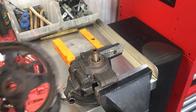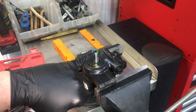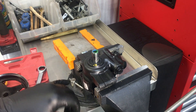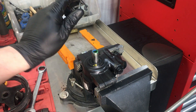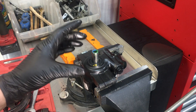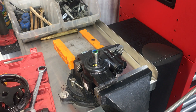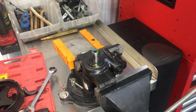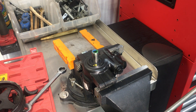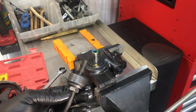Next, put the new pump into the vise same as before, and inspect the threads on the inside — make sure they're good to go. Being a reman unit they should be fine. We're also going to take a little grease and grease the shaft on here. This helps aid the pressing on of the pulley because it is a nice tight fit — you don't want it to cock and start to bind. This pulley presses on very, very tight, and the threads inside the C3 pumps are only M8 by 1.25, so it's a very small thread.